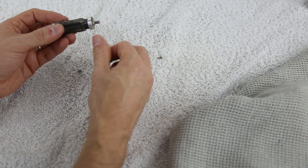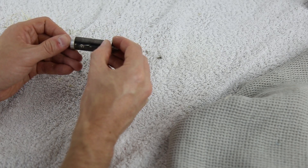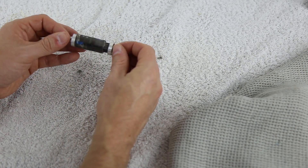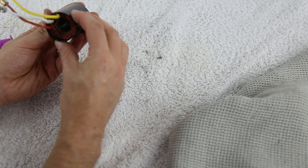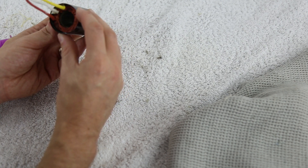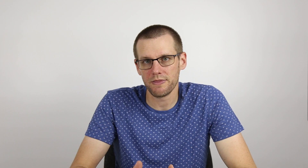It's just like a bunch of dust almost — that's what I see. I'm going to have to take this and vacuum it carefully. We can see a little bit of where things may have made contact; it doesn't look super smooth in certain areas, it looks roughened up. Inside the motor can, there's tons of this material still hanging out. There are a couple of rough spots that look a little odd, but outside of that, the windings look like they're in great condition. It would be easiest to verify that with a new rotor in place.